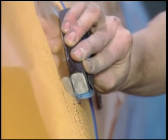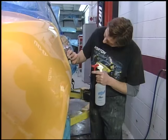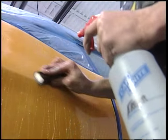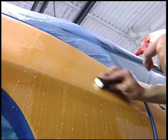What we're going to do is sand all that peel right out of it, and what we're going to use is an aluminum block. The reason we use an aluminum block is because we spend a lot of time making sure the body is perfectly flat — don't want to ruin it at this stage. The steps are: you're going to start with 800, go to 1200, 1500, 2000 grit paper. Sounds time-consuming? It really is.